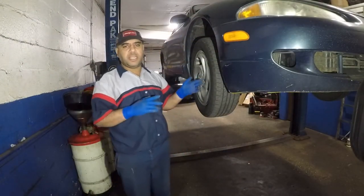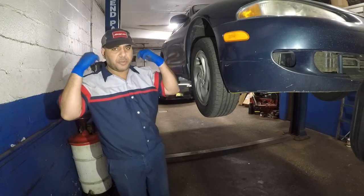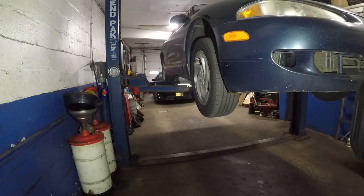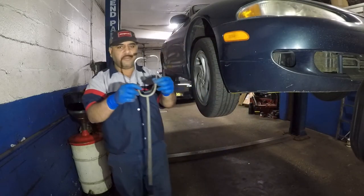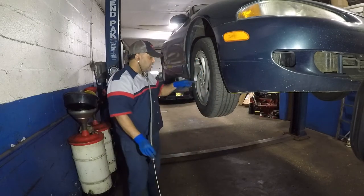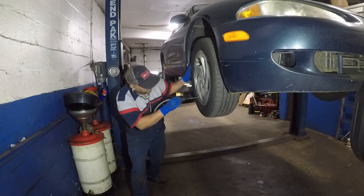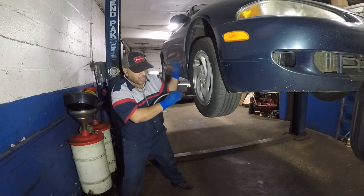Let's go underneath. I'm gonna show you exactly how to check it. I do have a set of scopes that you put on just like a doctor's stethoscope. So this is the component right here — the tool you put on your ears. What I did was I could actually see the control arms down over here, so if I put one on here and then I move it, I can hear the noise.